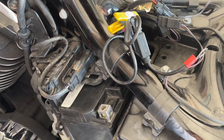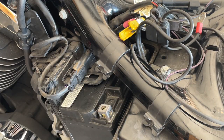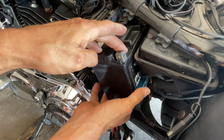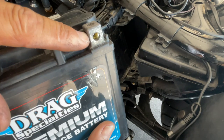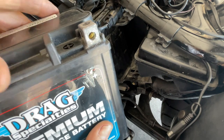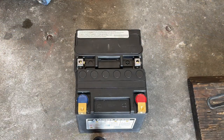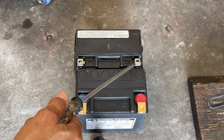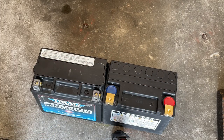Clip them together like that so you know which is which — this is for your trickle charger. With that we're done unhooking the battery. Now all we have to do is slide it out. This is what I'm talking about — these lead connectors, the battery posts are made out of lead, the hardware is sort of a pain. Now here's my new one. I like to compare the two — you can see the lead post versus the brass post. This is fully flush, solid. Looks great.